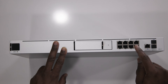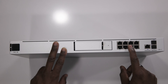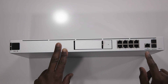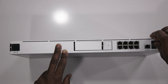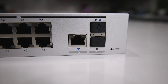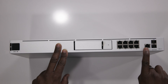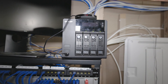I'm going to put my guest VLAN and some other VLANs on port six, and I'll have two cameras on this device as well. One of the big differences is that this second WAN port is now 2.5 gig — it was 1 gig before. We also have two 10-gig SFP+ ports over here: one for the WAN connection with my fiber, WAN 2 for my cable connection, and port 11 will go to the NAS — the network-attached storage — because I need high bandwidth for that.